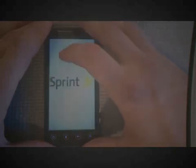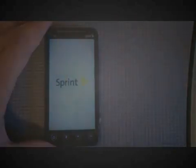Alright, so today I'm going to show you how to take apart the Evo 3D and replace the screen on it. This screen does have a crack. So basically, take off the back, take out the battery, and make sure the phone, obviously, is off.